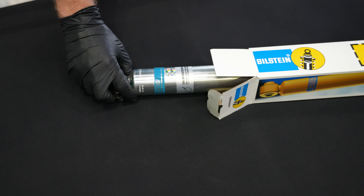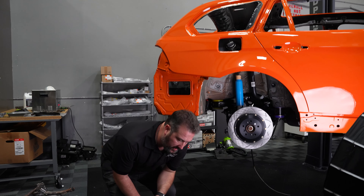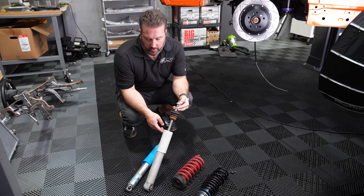Let's show the rear suspension. We have the Bilstein Club Sport installed — the shock and spring. It's a divorce setup with a progressive spring and a height adjustment perch. There's also the rebound and compression adjustment, except it's accessed up inside the car at the top. Comparing to the OEM damper from the E90 M3: there's no adjustment at all for rebound and compression, just a pretty standard damper. On the rear shock, there's an eye mount in the rear with bearings and a rubber bush on the factory unit. The adjustment knob would sit inside the trunk on an E90 or inside the hatch on this E91, where you can do all rebound and compression adjustments.